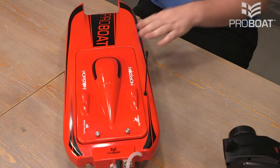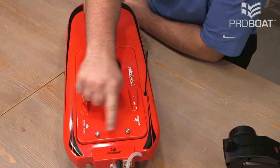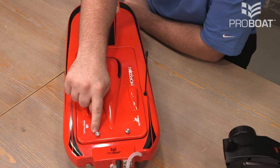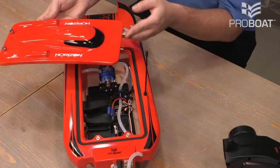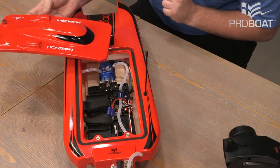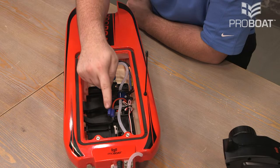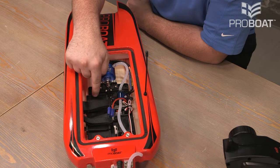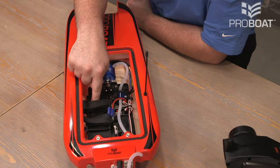When it comes time to get your battery installed, you'll have to remove the canopy. The canopy is held down with two easy-to-use thumb screws, and once those have been loosened, you can just pull the canopy off. You want to watch for the front prongs, and you should always slide the canopy back before lifting up. Right here is your battery tray — this is where your battery will go. This uses a 2S or 3S LiPo battery with EC3 or IC3 plugs. You can go ahead and get a battery installed using the provided hook and loop strap.